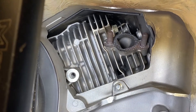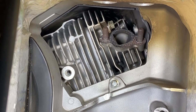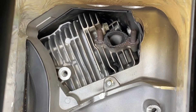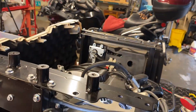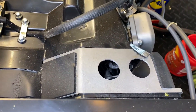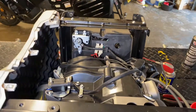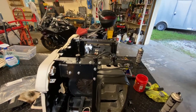From the back here, this is where the muffler bolts to it. You can see that slight angle — maybe 40 to 45 degrees angled up. The mating pipe that comes off the manifold goes into the muffler and bolts to that. The only way you can access it when the muffler isn't separated is to do this kind of disassembly. There are two plugs up top — I took those out already — and then you can get at those studs at that angle. They're perfectly accessible once you take the tank out, which isn't very difficult at all. Disassembling this thing is actually pretty easy.